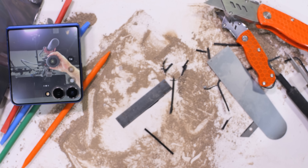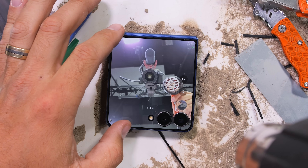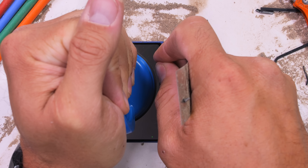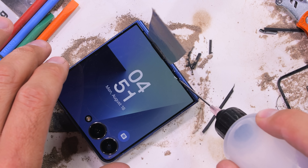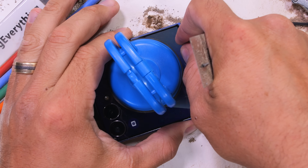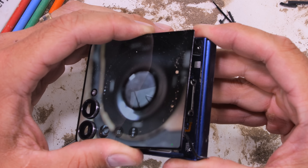To keep the screen in one piece, I'm going to try all my tricks. First, dripping isopropyl alcohol into the non-existent seam — I don't think this is going to help too much. Second, I'm going to heat up all 4.1 inches of the exterior display until it starts melting my fingerprints off. We already lost one display today. Finally, I'm going to jam that uber-thin pry tool between the glass and the metal and hopefully drizzle some more alcohol into the cracks to dissolve the adhesive. Apparently, if you go slow enough and gently work your way around the entire edge of the glass several times, it does indeed lift up and away in one piece. Congrats to myself.